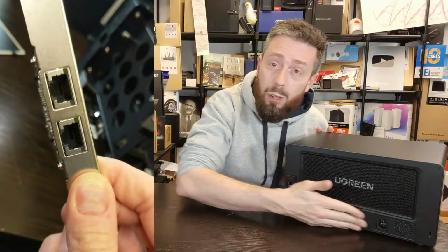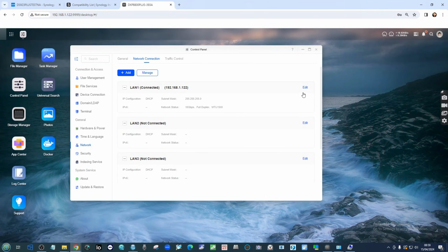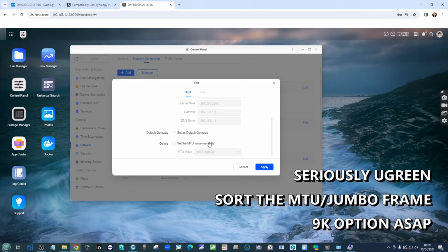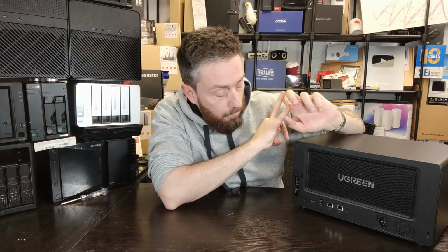This gives you a huge amount of network scalability alongside those 2 existing 10G ports, not 2.5 and 10, 2 times 10 GBE, a potential 2 gigabytes per second external network connectivity on there, depending on if you're going to take advantage of link aggregation, SMB multi-channel, and more. Now, in the software, a lot of these features and functionality for network controls, they're there, but they're not fully there. There is support of SMB multi-channel, but there isn't support, for example, of changing the MTU and the jumbo packet currently, something I'll talk about later on when we did our performance testing on this.